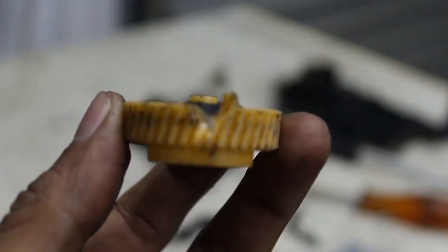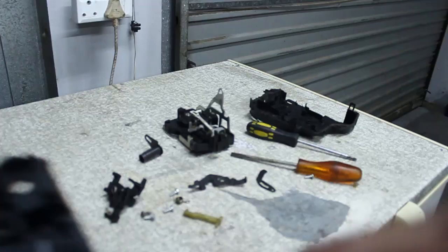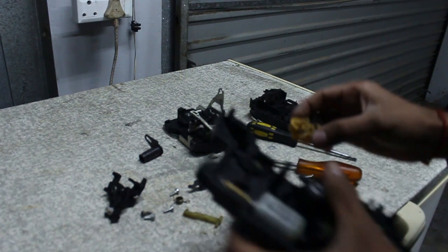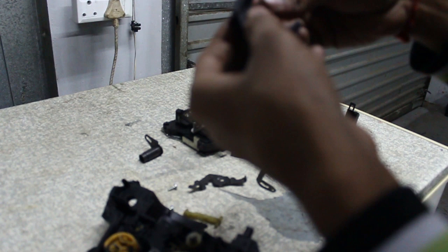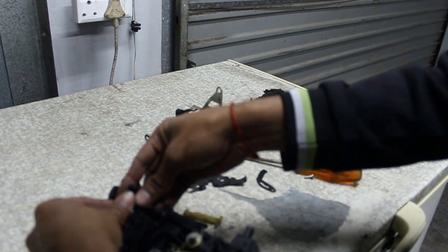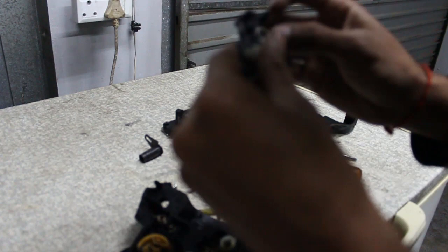Here it is — this is what actually broke. It sheared off the gears in two places, causing grinding noises and letting it run freely, which is what causes it not to pick the button up. If you happen to repair this, you'll get a new gear, slot it back in between the motor, reassemble with the spring going in here fitting with the corresponding holes, and it'll lock back into place.